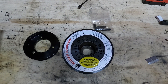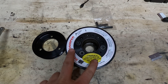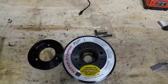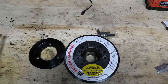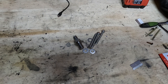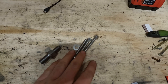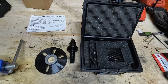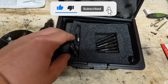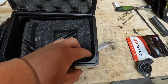Here's what you get in the box with the ATI street pulley — with the extra belt for power steering since I will be running that on the new engine. You get the pulley itself, this extra area to put a power steering belt, and the bolts to secure it. It also comes with an instruction manual, and I'll be following that to install the crank pulley today, as well as Brian's video at BB Speed, and I will link his video in the description. In the kit provided by Charlie is the crank pulley adapter that will adapt it to thread into the tool, and three bolts to be used when pulling the damper off the vehicle. In the box for the crank pulley installer tool, it comes with the hub for the crank pulley, the actual puller itself, some adapters for various crank sizes — none of which I can use for B-Series unfortunately — and a couple bolts and washers to assist with the pulling.